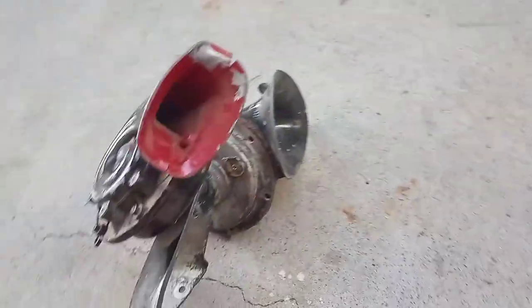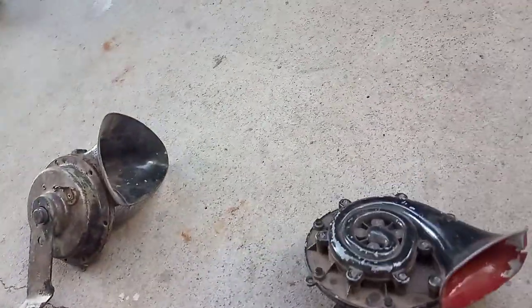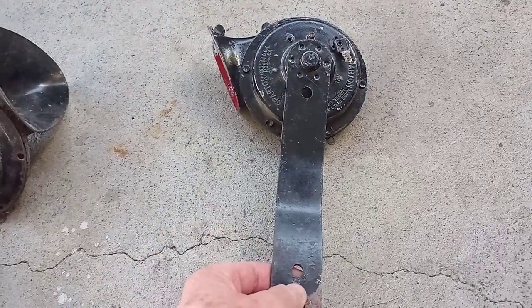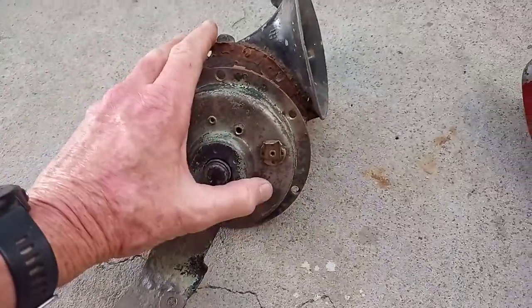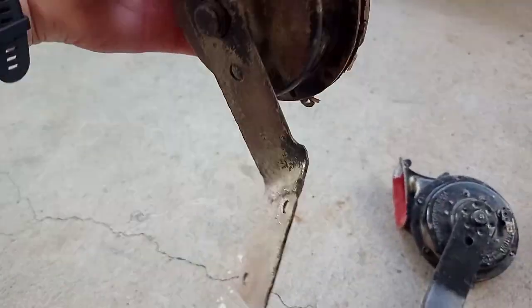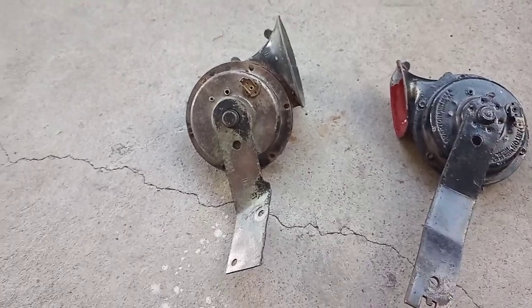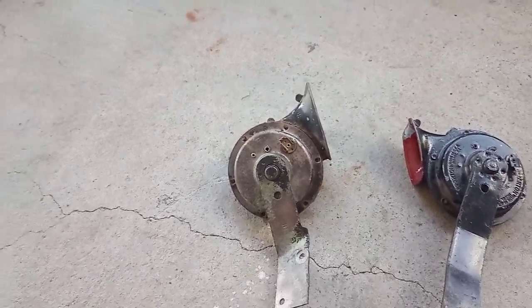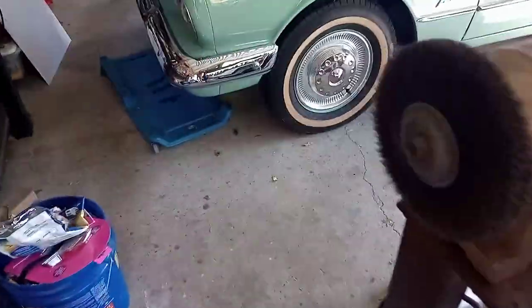Side by side, that's your difference. The second main difference is of course the bracket. The bracket on S series horns is a big long straight bracket, whereas the R series has a curved bracket. Left and right are just exactly opposites in the way the bracket bends. R series horns are mounted underneath the front bumper, under the gravel tray.